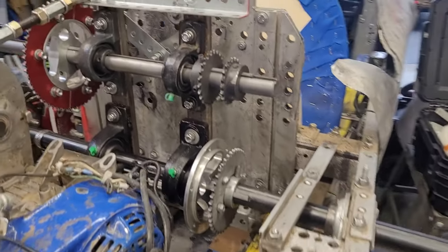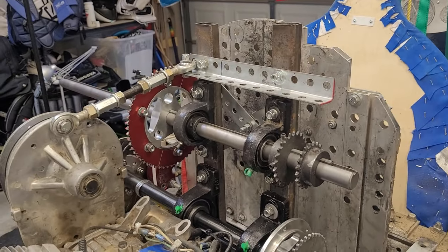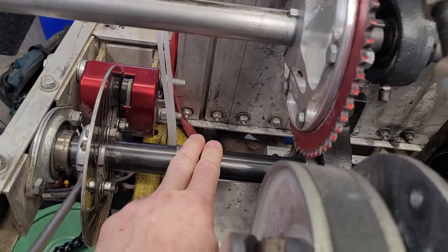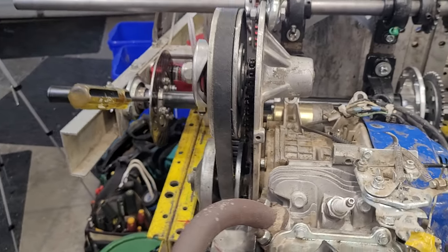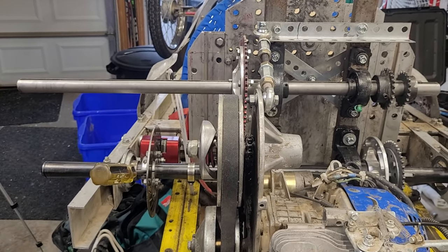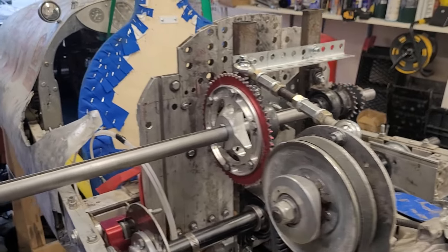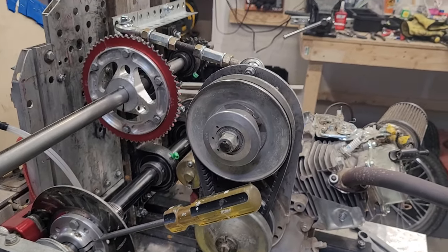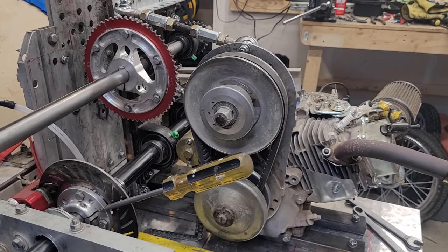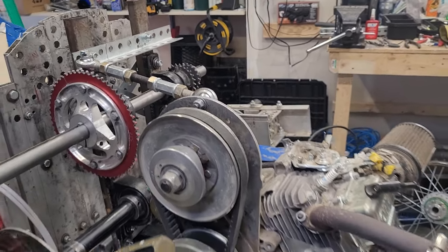You're probably asking: why the jack shaft? Well, if you go straight from the torque converter to the rear axle, like many cycle carts do, you really only have room for about — I think at most — a 72-tooth sprocket. That means you get only a 1-to-7 reduction ratio, or gear ratio. Many people go with that, but last year at Elmhurst I had a 12-to-1 ratio.